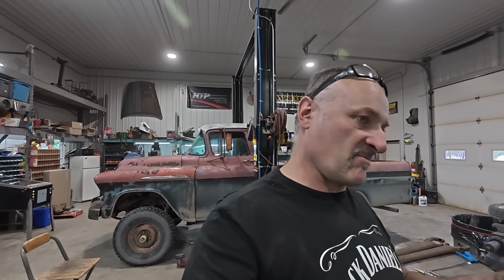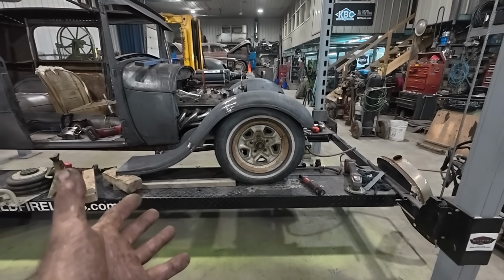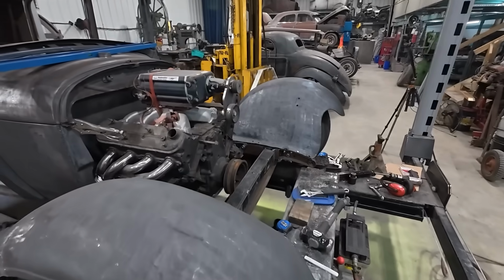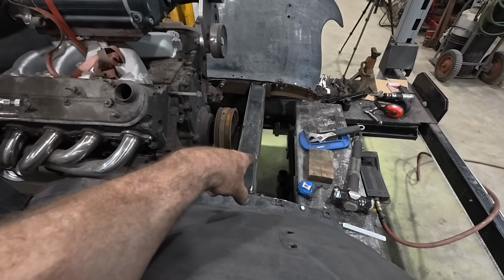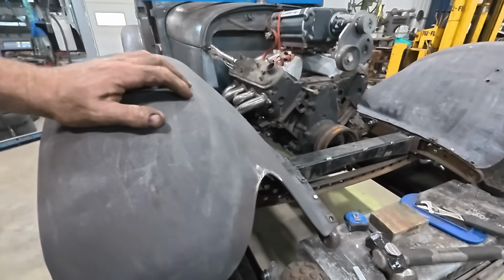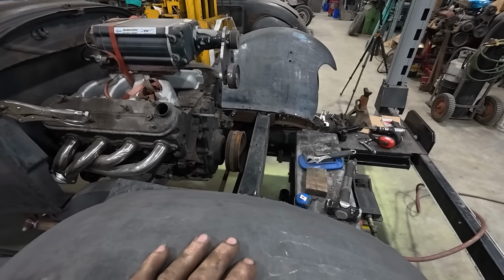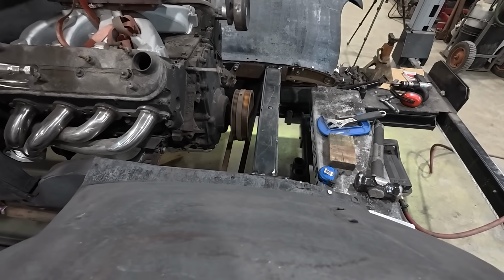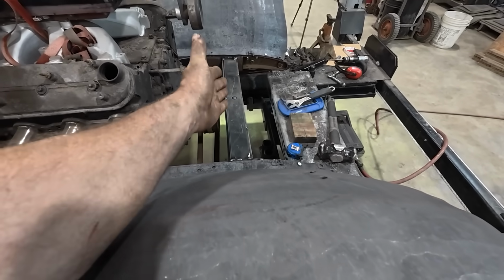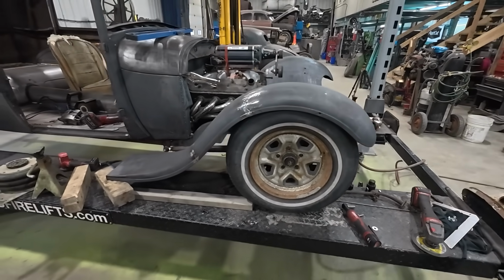That was about half an hour farting around. But look how much nicer that wheel looks. See? Much better. So we edged our cross member ahead. Because I have these adjustable shackles, I'm able to actually leave my cross member flat. Before, I had it at a little bit of an angle. Now it's perfectly flat, so that's good. I'll be able to fix this back part because it's kind of kicked out now. But anyways, with that said and done, both wheels look mint.